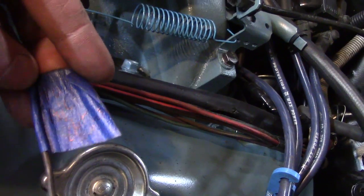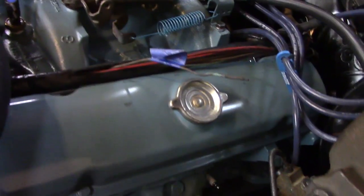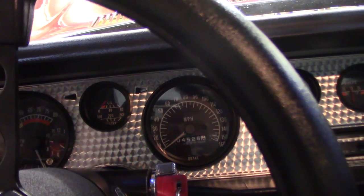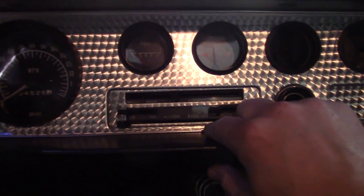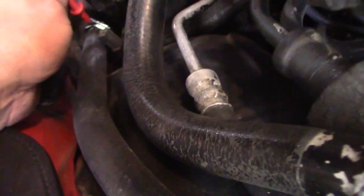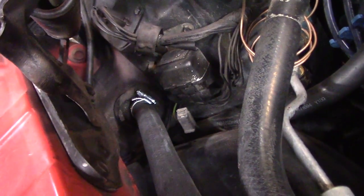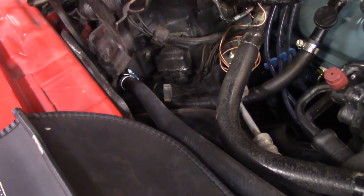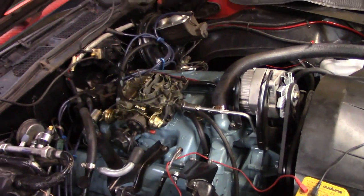I believe I found it - looks like I labeled it when I was working on this wiring harness. It says 'to AC compressor clutch,' I think. Pays to label stuff. We'll toss the voltmeter on there and see what happens when we hit that switch. Looking at zero volts with the key off. Flipping over to AC - then we've got voltage. Not 100% sure if that is the ambient switch or not - maybe it's bad. I do believe that is the ambient switch. I think I'll jumper it and then see if we have power over on our compressor clutch feed wire.